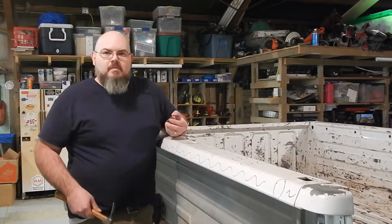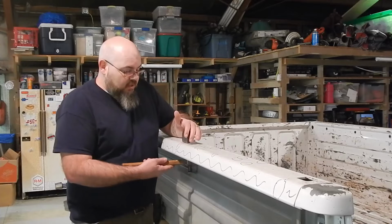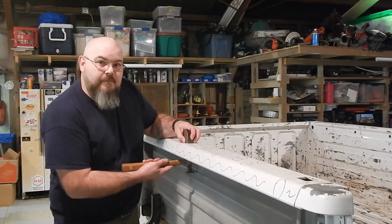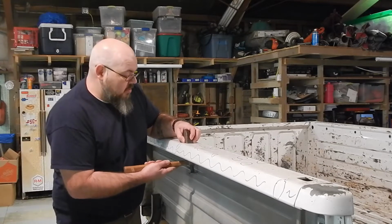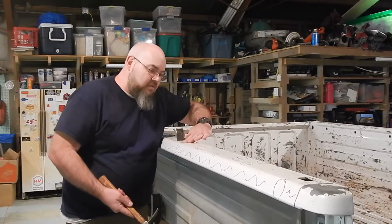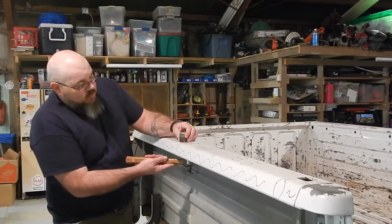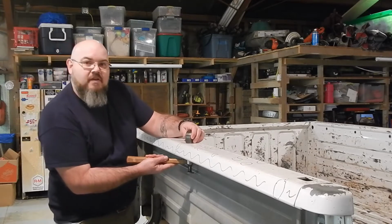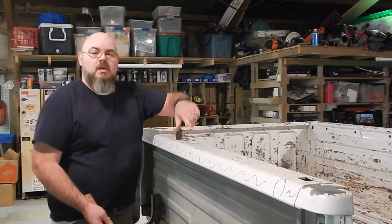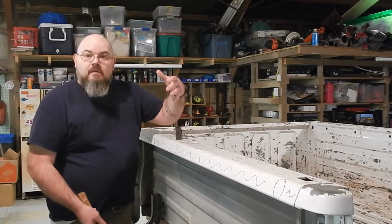and then deal with that. But when we're working this way, guys, you can actually just put your dolly right on top of your dent and just kind of tap. And the dent is going to come up. And like I said, you're not just really hammering on that thing. Now if it's a bigger dent, you're going to want to kind of hold your dolly out around the side of it a little bit, because what you're also not wanting is you don't want any of that other metal that's already high enough. You don't want it coming up even higher.